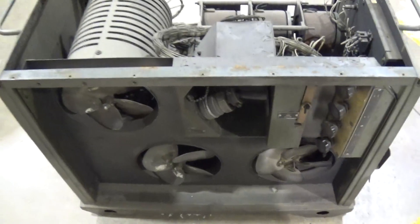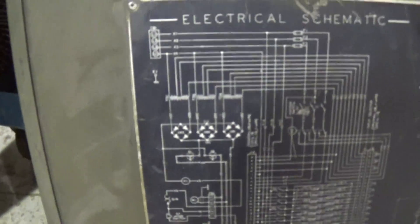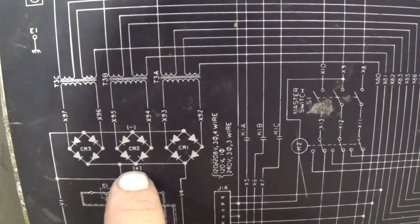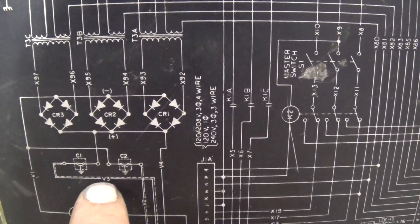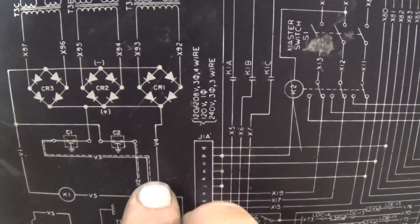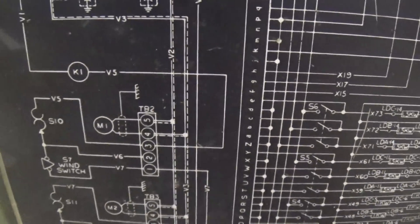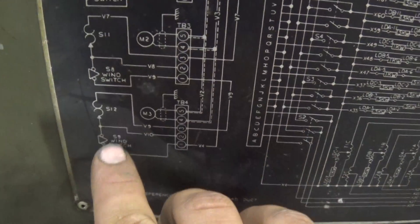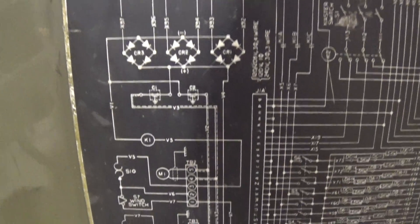Let's take a look at the wiring schematic — luckily it's attached to the door. Here are those three input control transformers, feeding the rectifiers. The rectifier outputs are all paralleled, and they run through two capacitors — just filter capacitors, I imagine, to clean up the output a little bit. Then from the capacitors, the three fan motors are all paralleled. So they all run at the same time, regardless of what combination of heating elements you're energizing. And of course here are the wind switches — that's their only function, those transformers — it's all in the control.